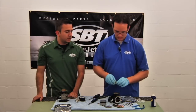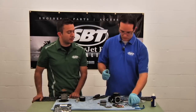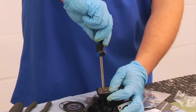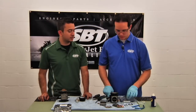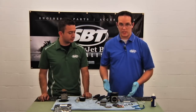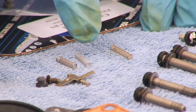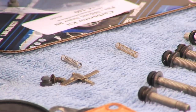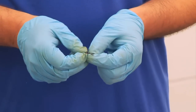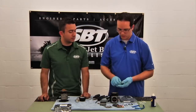Now we're going to put the cover back over the jets and put in our screws. When we're putting the screws back inside the carburetor, do we need to worry about any torque spec or is hand-tight sufficient? I actually just want to get them snug as possible. Now we're going to replace the pop-off pressure spring and the lever. The kit does come with two different springs — what's the idea behind that? Well, different carburetors take different springs. A good place to start is to compare what spring you have in your carburetor to what's in the kit — this one is pretty close. If neither spring works like we want, do you have other spring tensions available on your website? Yes, correct — you can order all the different sizes that would normally be available from Mikuni.